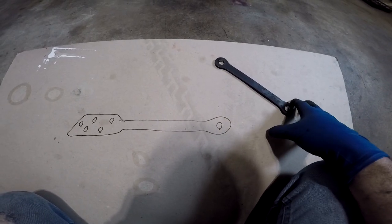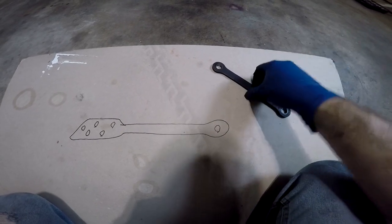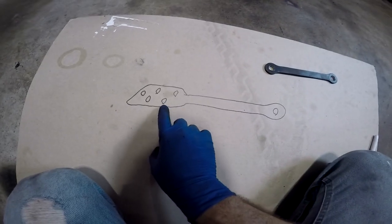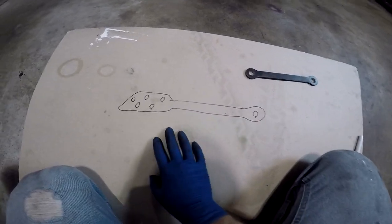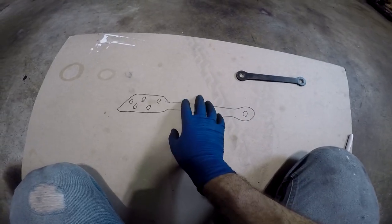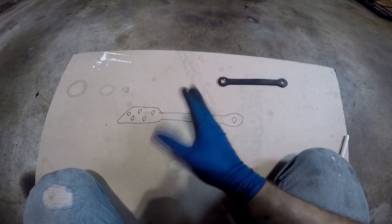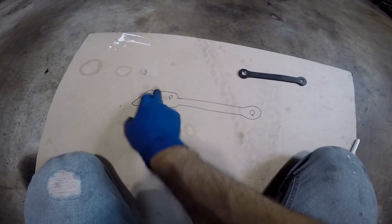One thing that's frustrating for a short rider or new rider trying to fit their bike is that every time you want to change the height, you have to buy a new set of these. But if you look around online, you'll find some dog bones that instead of just having two bolt holes, have one hole on one side and a series of holes at different lengths on the other side — meaning that link is adjustable. You can try the bolt in different positions until you find the height you like, without having to buy four or five sets. So if you don't really know where you want your bike to be, get the adjustable dog bones so you have a couple of different settings to try.